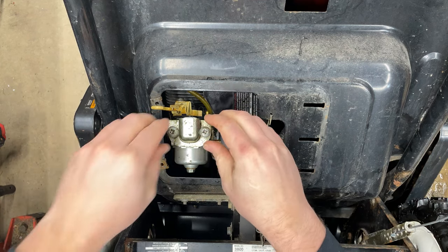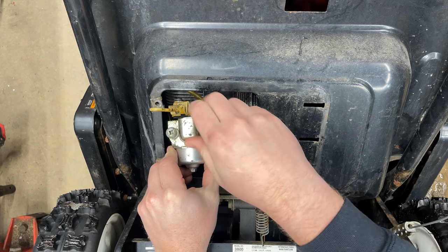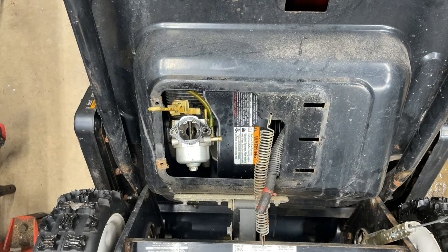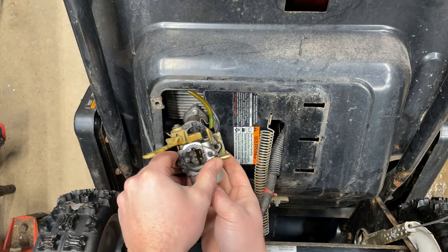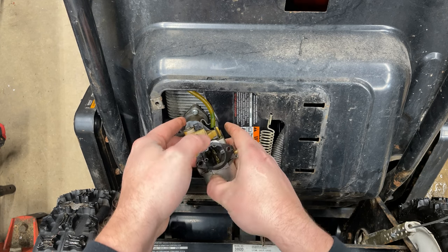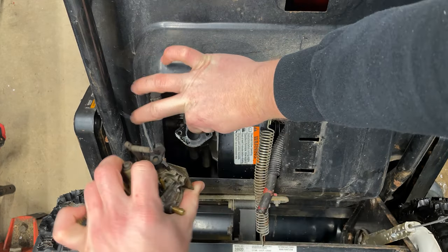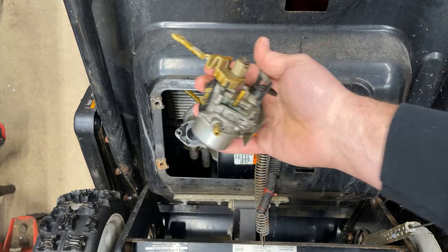Be careful — you want to make sure that you know where the gaskets are and how they're aligned. Then we just have this throttle linkage that's tucked down here that we need to be careful about. This air inlet — down in here it just turns and allows the linkage off. Just like that. There's the carburetor — that's what we're after. Leave this gasket in place, leave the linkages just like that.